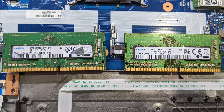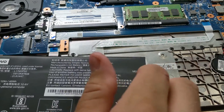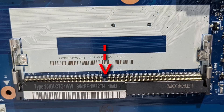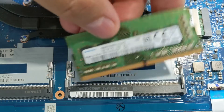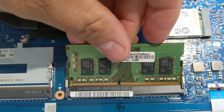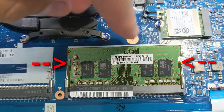Here are both chips side by side. It is recommended to disconnect the laptop battery when you are installing the RAM chips. There is a notch that you need to match — if it doesn't match, turn the chip around. Insert at an angle, press it in, then set it down and the clips on the sides will lock in place.